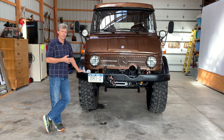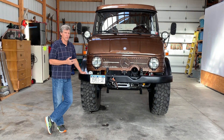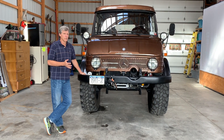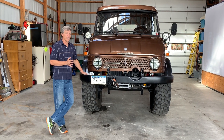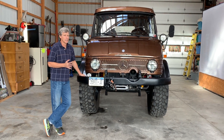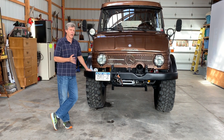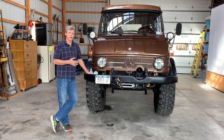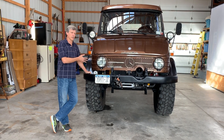The transmission is a factory rebuilt 16-speed — it's the latest design that would fit in these trucks. It gives you 16 forwards and 8 reverses. All the gearing in the axles is brand new with all new bearings and new seals. The final ratio is 4.93, giving a top speed of close to 80 miles an hour. The 16-speed transmission also has an air-activated underdrive that knocks it down 22 percent in any gear, so you can go very slow but also keep up with highway traffic.